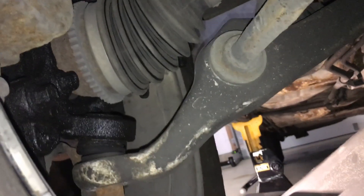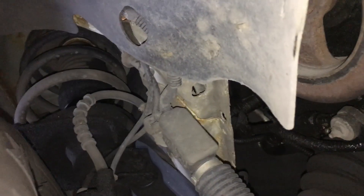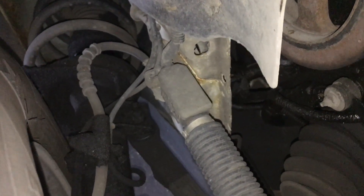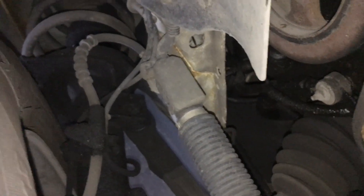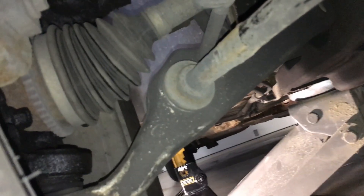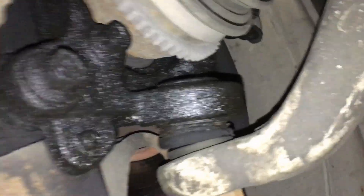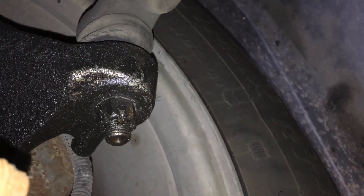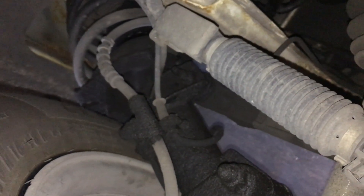It's been going on for a while - look at that, that's all from the shock. You can see it on the strut there. It's very obvious, and it just goes to show what a jounce test and a visual can do. At this point you know that strut is done for. Make sure the rest of the suspension components are not loose or worn or coming apart. I noticed a couple things right away - there are no cotter pins on the steering here, nothing in there either. But they're all pretty tight - it's just that shock, it's done for.